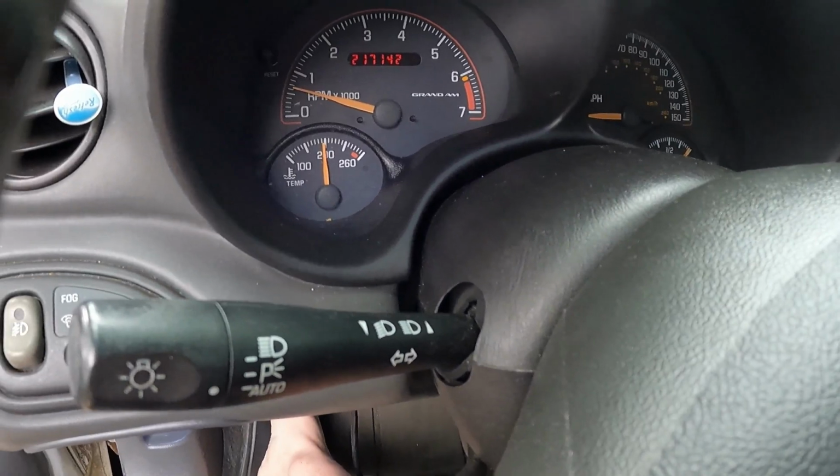Like I said, the low setting for the coolant temp itself is gonna be 223, which we can go on my laptop and I'll show you guys. Actually, I can even just pull the tune directly off this car to show you exactly what we're working with. Another note, that's now dropped to 186 from those fans kicking on. But what I want to show you, as that says 186, we are pretty much right at the center.